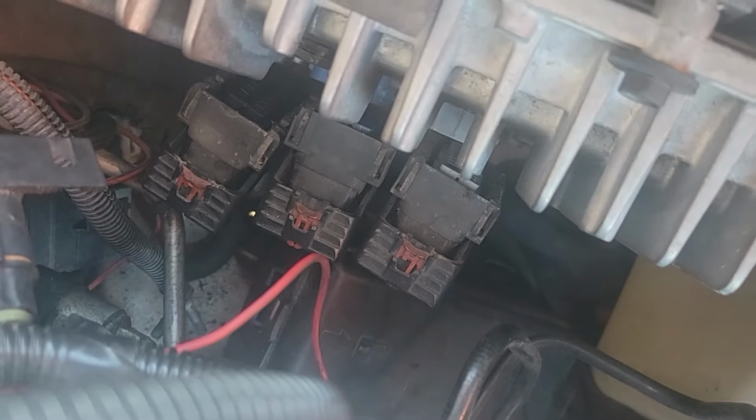So right now, the first thing I'm doing is resetting it. I saw a couple of YouTube videos, and they say the first thing you do is reset it and check the fuses and everything. So I disconnected the batteries, then disconnected the TCM control modules, and I'll show you better than I can tell you. I don't know if you guys can see, but that's them disconnected right now. Online, the video says you need to let it sit for 10 to 30 minutes. I'm gonna give it a full 30 minute reset. I'd rather save time doing 30 minutes than doing a 10 and then a 30 on top of that.